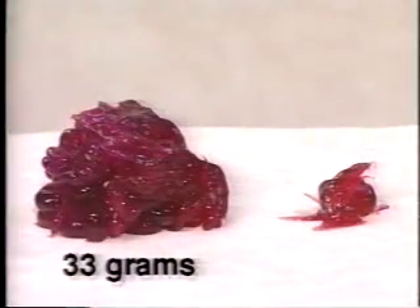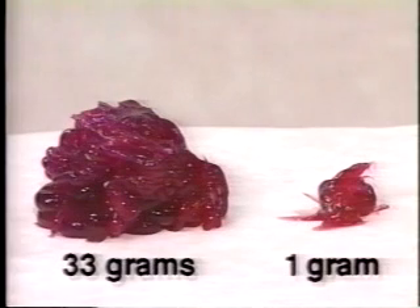On the left is the total amount of grease held in the lube path of a properly lubricated 1710 universal joint. On the right is the total amount of grease that the air displaced at the base of the PPV valve. As you can see, the amount of air entrapped at the base of the PPV valve cavity is insignificant.